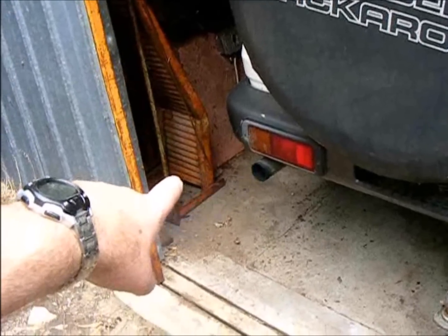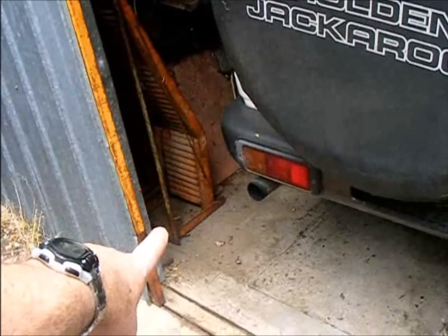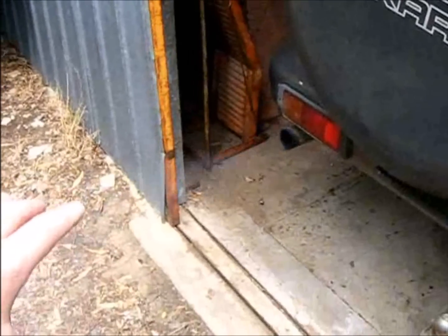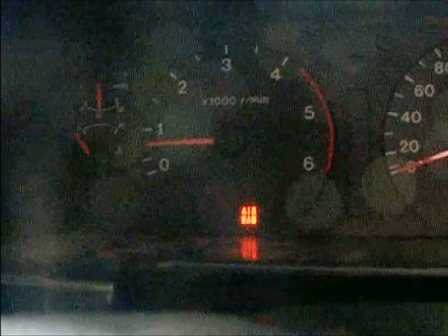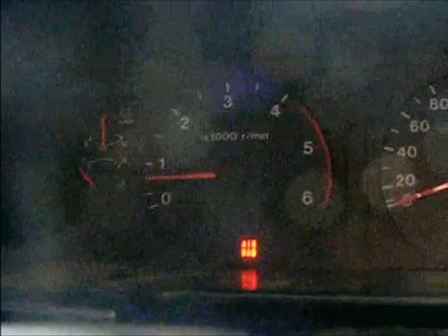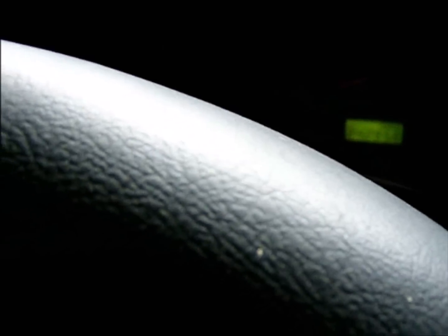this one has got the fault that the water from the cooling system is getting into the engine, and you can see this white smoke here, which will come out in volume when the engine's a little warmer. Here's a symptom of there being water in the diesel fuel. You notice it's running smoother now. It's idling at about 750 RPM, which is standard specification. The engine's warmed up a little.